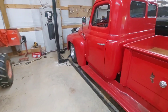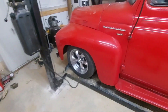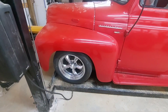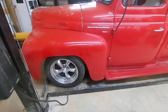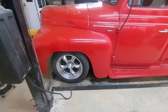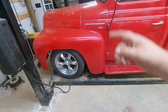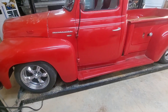It's just another manic Monday. Today's task is taking off basically all the brakes on the front — new calipers, new pads, new hoses, and getting the rotors turned. We were looking for a slight vibration, thought it was the motor mounts but it wasn't. This brake caliper locked up on Friday when he took me home after we finished doing the motor mounts.